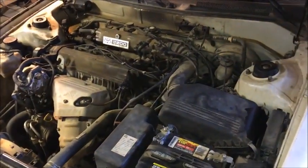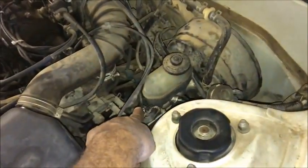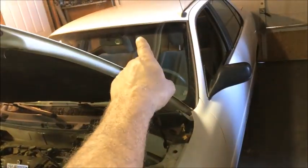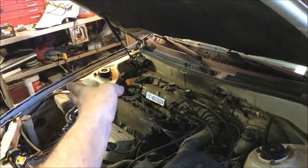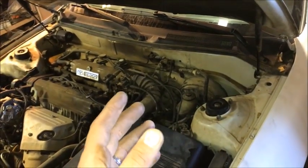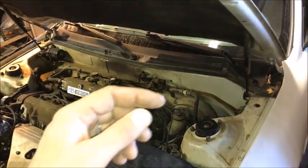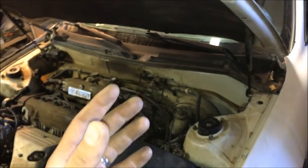We have a 1996 Toyota Camry here. On this brake system, the master cylinder front line goes to the driver's front and passenger's rear, and the side line goes to the passenger's front and driver's rear. If you have low pressure in one caliper, you can probably assume it's a bad caliper. You can disconnect the line behind the caliper to check flow, or check the bleeding screw in front of the caliper.